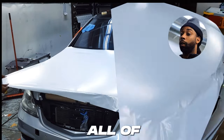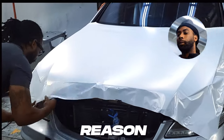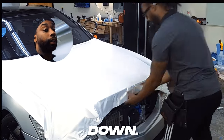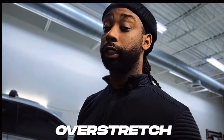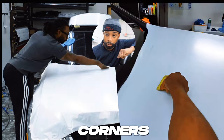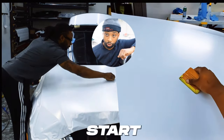It's okay if not all of the vinyl is perfectly glassed out right away. You can use a little bit of heat just to make sure it relaxes down — that's what you want to do. Do not overstretch it and pull for dear life. Once the panel is glassed out in all four corners and fully smooth, then you can start your squeegee.